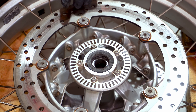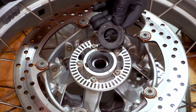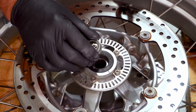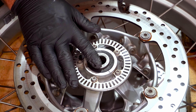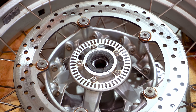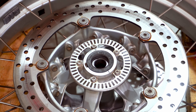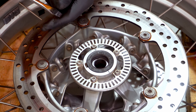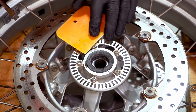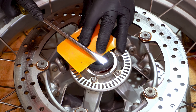I'll just get this dust seal out. This one's a little bit bigger than the other side — you'll see the difference — because this one actually has a collar that fits in there, so the seals are actually different. I notice there's a little area here which I could probably get down into, but I think it's probably safer if I just do the same thing and come in under here to take the seal out.